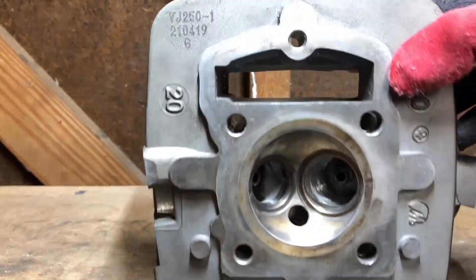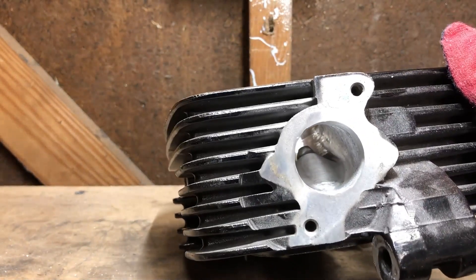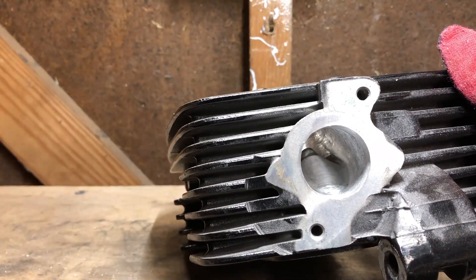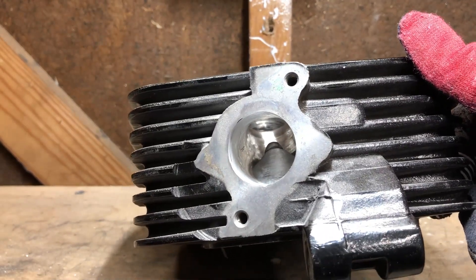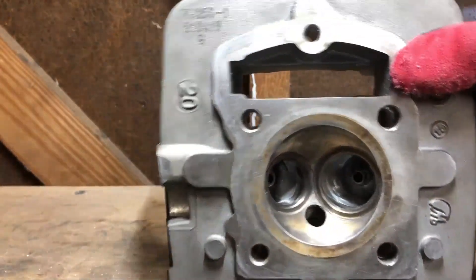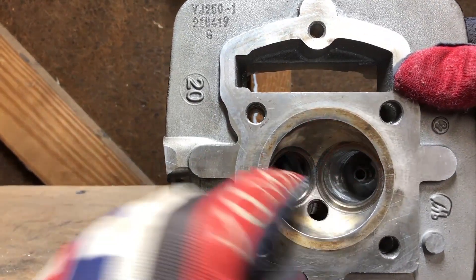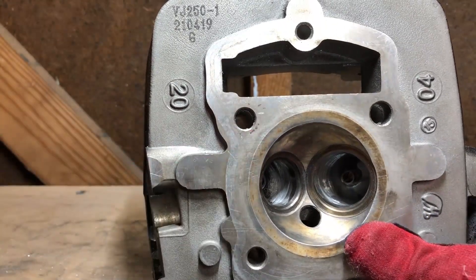In this case, the intake is opened up just about as far as I need it to be. I'm going to check with a micrometer to make sure it's adequately sized, but it's right about where I need it. So I can begin to start blending, which will be covered in the next video — I'll come back and show you everything smoothed out and get rid of the inconsistencies you can see on camera.